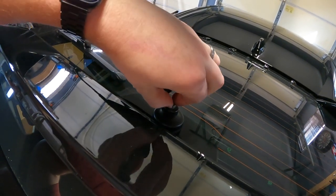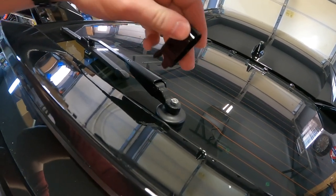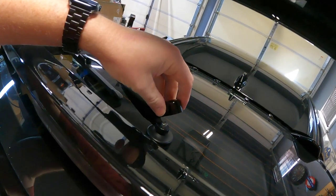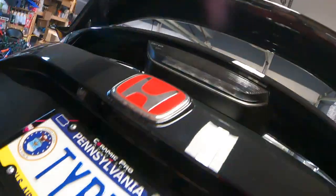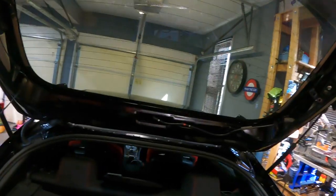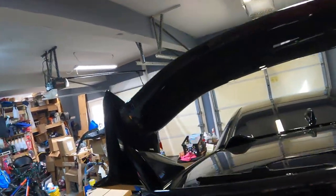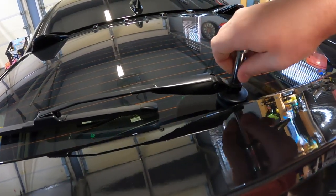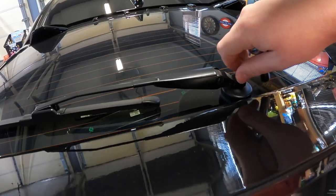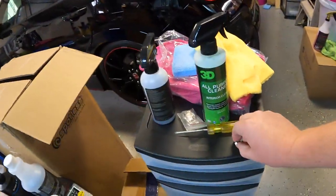You need to flip the wiper arm back and take that nut off so you can take the wiper arm assembly off. Super easy stuff, but it has to be done. This cap lifts up and you can pull it away — make sure you get that off so it doesn't fall onto your freshly ceramic-coated black car. All right, 10-millimeter once again. I've got a cotton shirt on to hold the trunk in place. I've had this apart already so it's not loctited on or anything like that. This whole thing can be done with 10-millimeter — that's pretty cool.